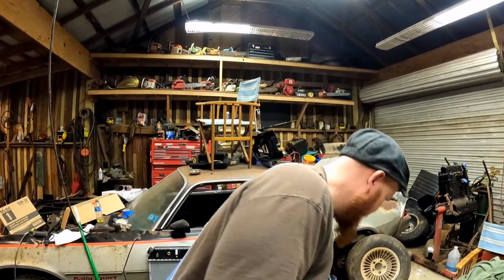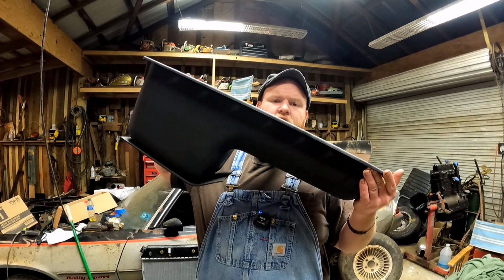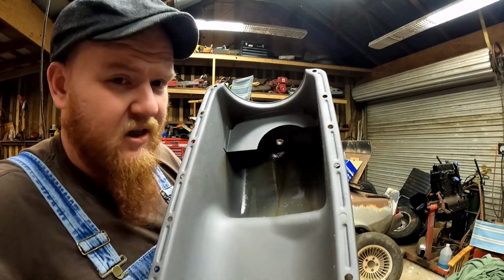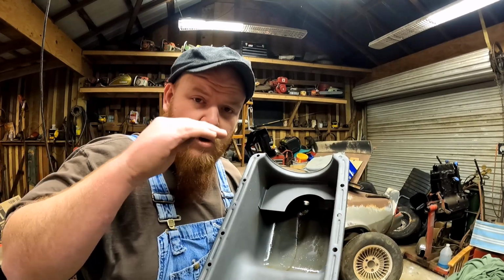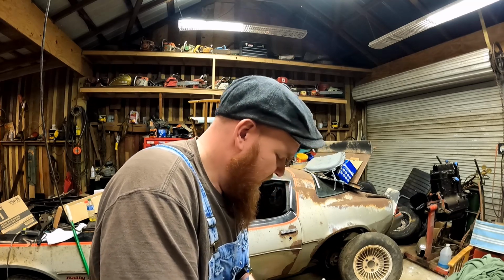So this is the oil pan that's off of I think like a '59, '60, '61, something like that wagon. I can't remember. The wagon was in horrible shape, but this oil pan is in really good shape. But even though it's in perfect shape outside, it has no dents, nothing, it did have one hole in it, and I don't know that you can see it. It's up in the dark recesses, but up here near the drain, there's a little spot where it was rusted through where water had been sitting in the bottom of the oil pan. Now, we ran a spot of weld over it just in case. I don't know that it was all the way through, but we wanted to weld it just to make sure.